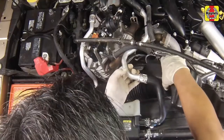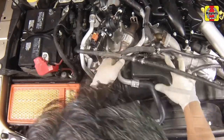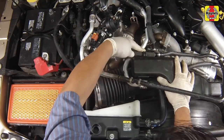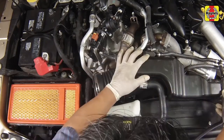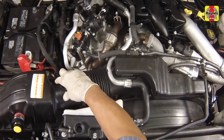Lift up the secondary coolant reservoir hoses and install the intake air resonator assembly. Install the air filter housing top cover and connect it to the intake tube, then connect the remaining resonator assembly ports. Tighten the clamps securely and connect the electrical connector to the mass airflow sensor.